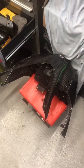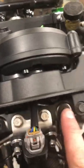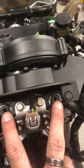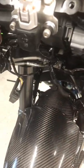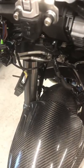Hi, I'm back again, nose cone off. I nearly forgot to tell you about two 10mm bolts outside under the screen. So you have to take the screen off first, 6 bolts on the screen, and that will pull out, no problem at all. And then there are 2 bolts there, and then you've got the plug for your headlamps. I think it's indicators or side light. No, it'll be side lights, because the indicator's not on there. Side light the other side,